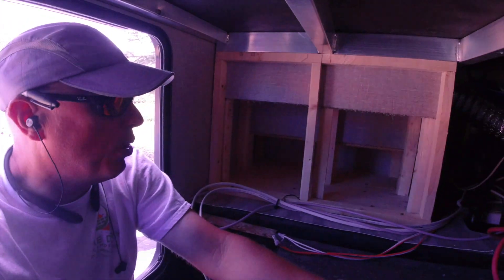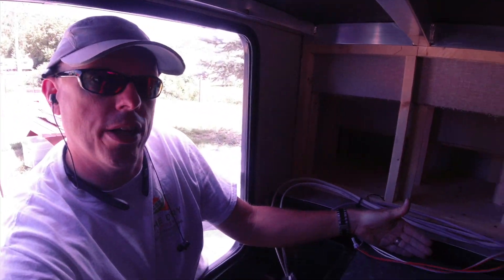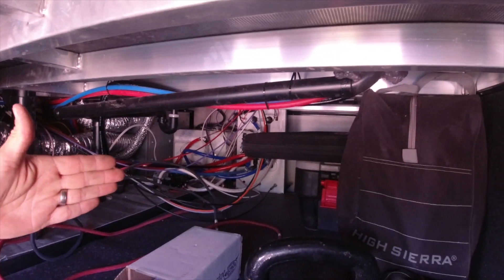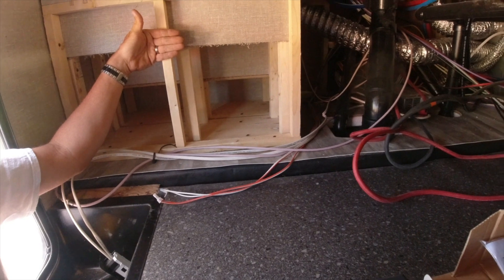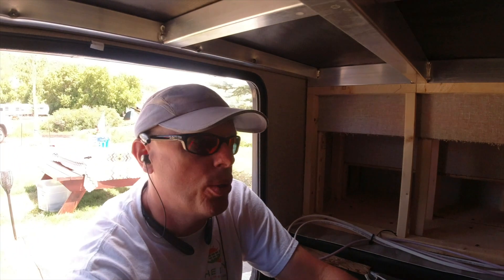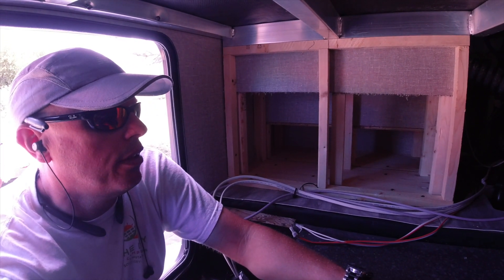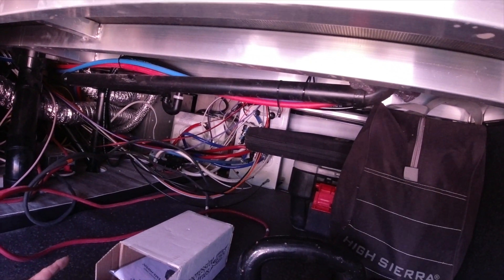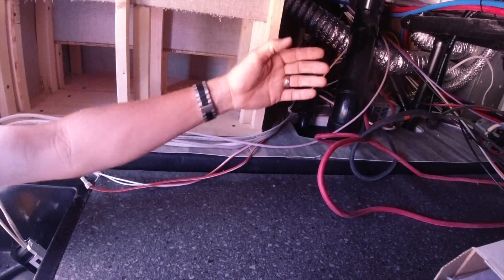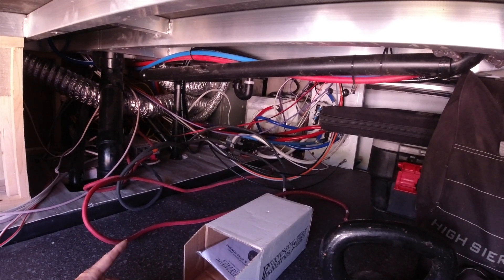I'll show you that later. They did have a piece of wood right here — you can see the screw holes — and they brought it out, then put the wall in and it angled over towards the wet bay. What I'm going to do is put an L-channel aluminum here and go all the way to this wall. They opted to have the batteries put under the bed, because they want it easier to expand. So I am going to take the wall down from here all the way down and square it off, move the water pump over a little bit, and neaten up some of that plumbing and cable lines — do some wire management on all that.